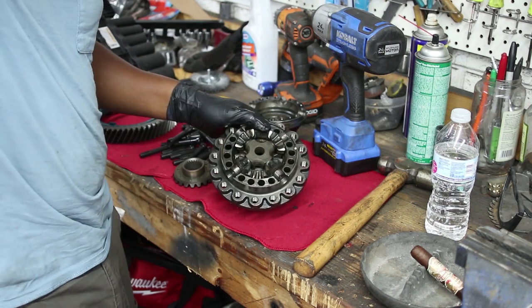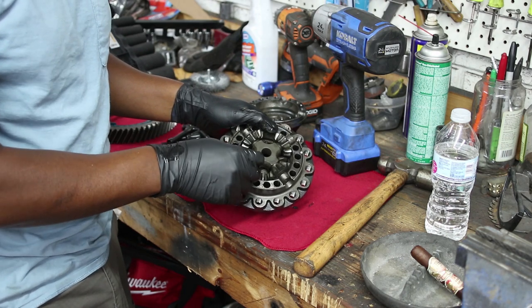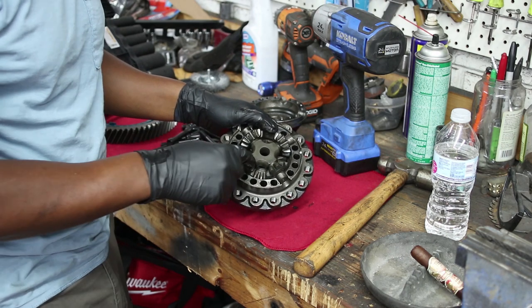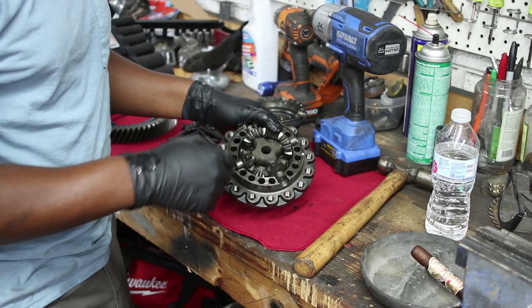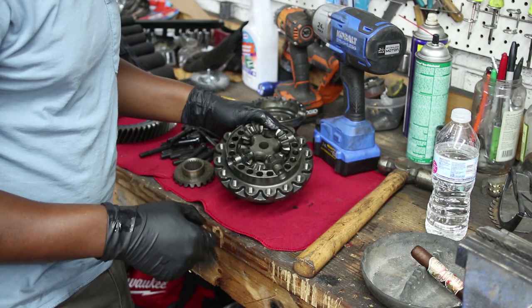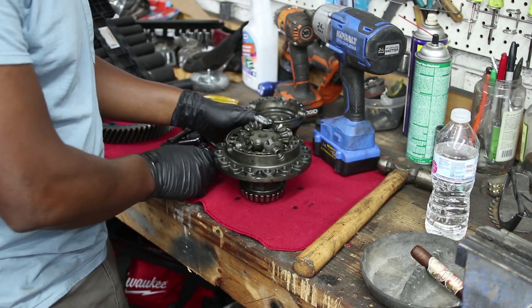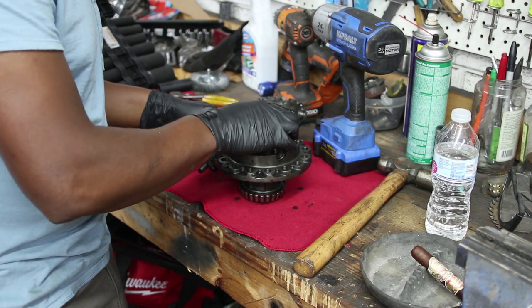You know, in the Mazda G-Series, these are truly just floating. And if you jar the transmission enough, these gears will fall out of alignment. And you got to pull the transmission apart and put all this crap back together. Whereas this is brilliant. It's genius. Well, it's not genius, but that's just the way things should be done, you know?